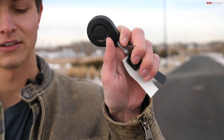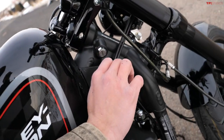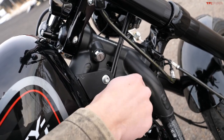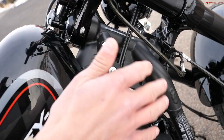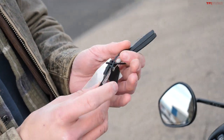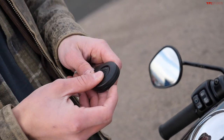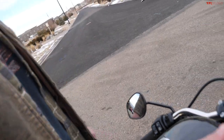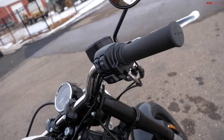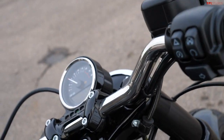Just because a lot of the technology on this bike has its roots in older bikes doesn't mean there isn't any new technology at all — a key point of that is this proximity key. Right below the lock for the handlebars, where there was an ignition in the past, there is no longer anything there, because the proximity key does all the work. You do have a physical blade-style key, but only to lock the forks — to get the bike running, just keep the fob in your pocket, move your hand to the handlebar, hit the kill switch to the run position, and start it right up.